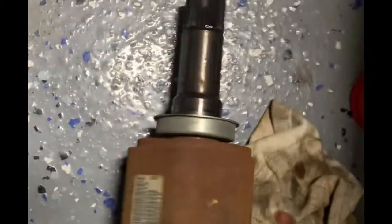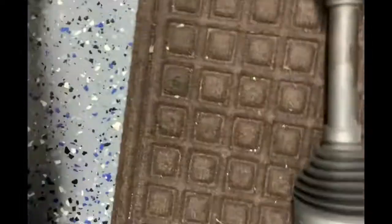This is what's happening — I was getting significant vibration. The side that goes into the transmission is very wobbly, and so is this side, but it shouldn't be that wobbly. It'll wobble a little but there shouldn't be that much play. Let me show you the new part — you know, it's not that wobbly.